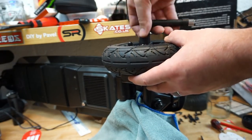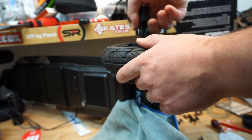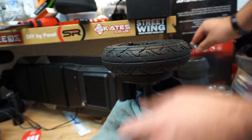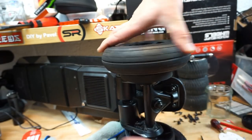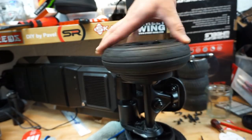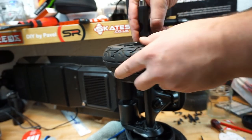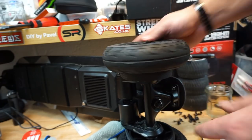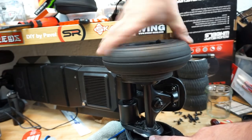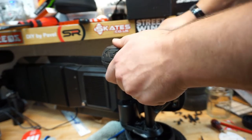Add the speed washer and the lock nut. Tighten all the way down really hard, but then release it about half a turn. You need to get used to the feel of how the motor spins and how the wheel spins — you don't want it too tight, but you don't want it loose either. Over-tightening this nut is not very good. I kind of feel it — being nice and free and not having any wobbles.